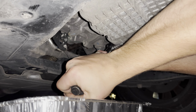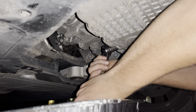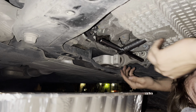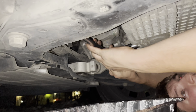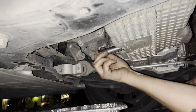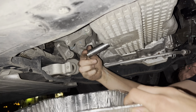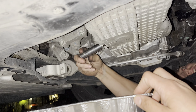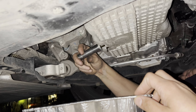You're going to want to get something to drain your oil into. In my case I'm using a lasagna pan, which was not the best scenario — I was doing this for a friend and he didn't have one. The ratchet didn't work so I'm using a hand tool. Make sure the pan is underneath. The car was running not that long ago so it's going to be a little hot — be careful.